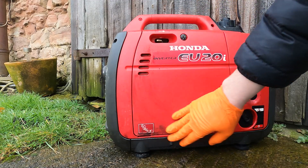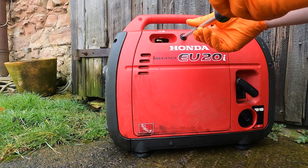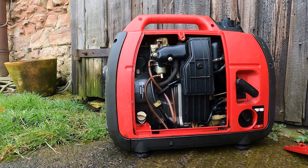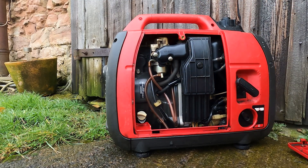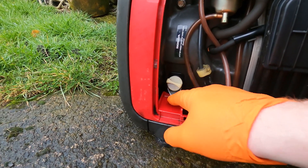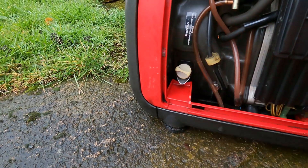To do this, on the side panel here where the choke is, there's a screw — a flat blade. We undo this and the panel opens up. Remove the panel. Right here, that's the dipstick and oil drain. There's a small channel there, so when you take that out and tip the engine on its side, the oil will pour out.